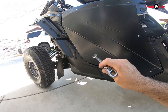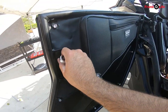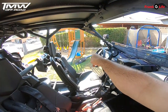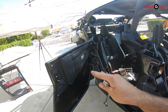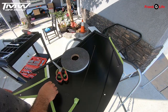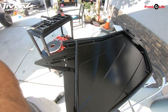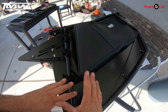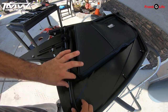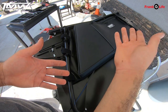Let's get to it — we'll do the front door. It's pretty much the same thing as the rear door: you're going to install the screws, the bag, the nuts, and then put the tape on there. Remember to put these two studs on here first before you tighten the others up, because you won't be able to get those in later. This is going to be for your latching system and we still got to take the latches out of the OEM doors — that's the only part you reuse when you put on these TMW off-road doors. These front doors are just a little bit different, mostly in shape but pretty much the same as far as how they're assembled. The only thing different is on the bags — there's a Velcro strip on the front tube, versus the other ones that are bolted down through the bolts. The rest of the bag is sandwiched between the door and the skin, same as the rear.